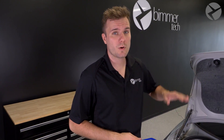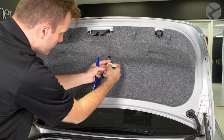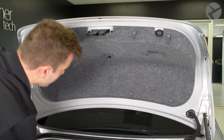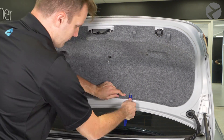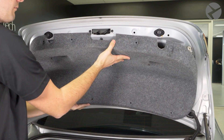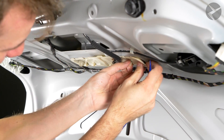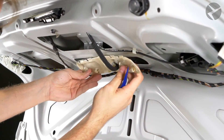To remove the old handle and reinstall the new one with the rear view camera, we're going to need to take off this panel. First, remove the emergency trunk release handle by bending the plastic center tab and sliding the metal tab out. Then take your pry tool and remove the eight fasteners around the trunk panel — slide your tool under the head and pull back. Once you set the panel aside, remove this plastic cover using a combination of your fingers and the pry tool, then slide it out of the way.